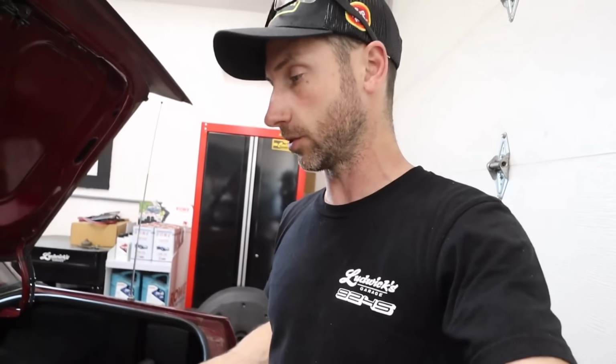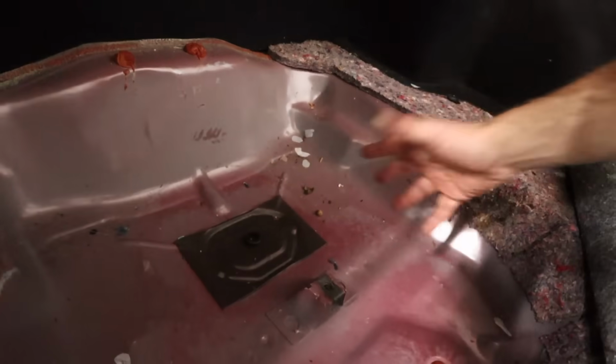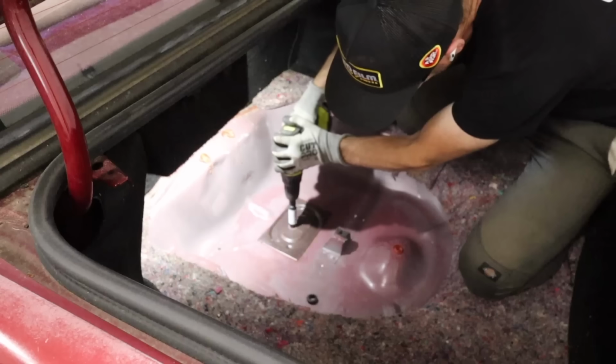So basically when you air the car down, that air has to go somewhere. So there's an outlet out of the manifold for your exhaust, essentially. So when you air down, the air gets purged out of the manifold and out of an airline rather than just inside the trunk. And then when we do our management later on in another episode, we'll figure out where exactly all the airlines can go underneath the spare tire, how they can get guided together and come up from underneath the false floor carpet and make it nice and hidden.